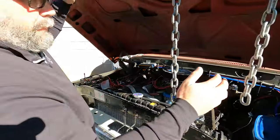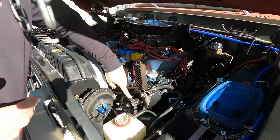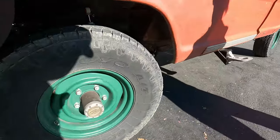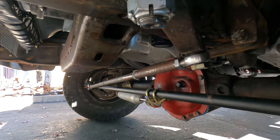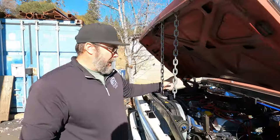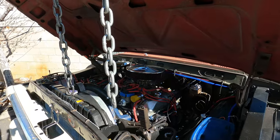This truck did not come with power steering, but you've got a power steering pump now, and if you sneak underneath and look through the wheel you can see the steering box way back in there. They went ahead and did a power steering conversion — they're getting a little older, as is the truck. Simple mods: five-speed, great-running 390, power steering, and 205 transfer case.